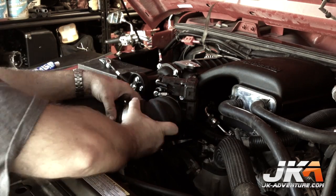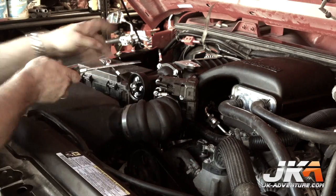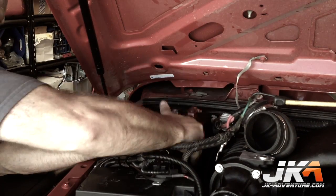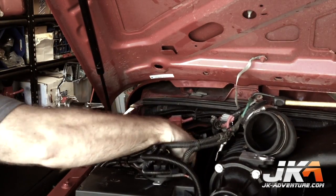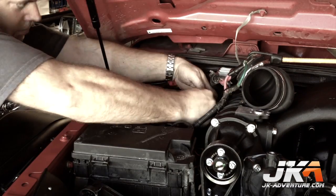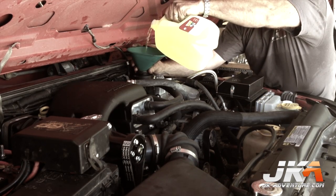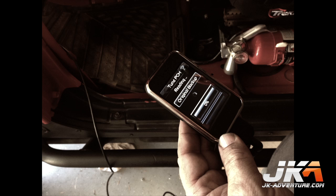Install the provided air tube on the air box and throttle body using the OEM clamps. Carefully place the battery into the new battery box, being careful not to disconnect or damage any wiring. Install the included battery hold-down bracket. Fill the system with a 50-50 mixture of coolant and distilled water. After reconnecting all electrical to the battery, use the Diablo tuner to install the tune received from Magnuson.